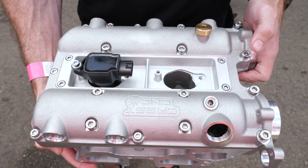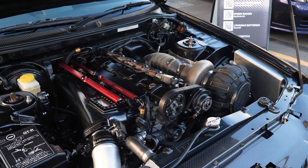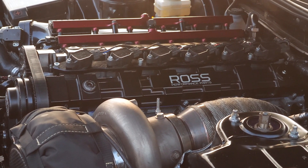Another change made is to the coil mounting. The factory coils on the Subaru EJ series obviously have limitations, and anyone considering these aftermarket cast heads is probably pushing well beyond factory power levels. You can still bolt in a standard coil, or there's a mount included for an R35 coil or one of the new IGN35A coils — which is an R35 base with an IGN1A coil — giving you the freedom to run whatever you want.